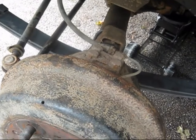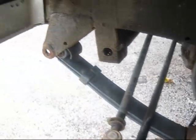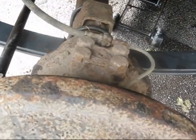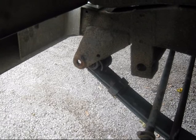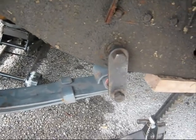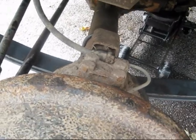I'm still having a problem trying to locate this side of the U-bolt and the pin. As you can see, there's quite a bit of movement left in there — it's not tight at all. So what I did is I dropped the front pin out, located the pin on here, put the U-bolts on and just pinched them tight so they don't come undone. Now I'm going to try and pull and shove and squeeze to get it on there, so I can put a small pin in to locate the hole and tap the bolt through. At least now I have some leeway and it isn't going to come loose. The shackles will travel further forward and they are loose, so I may just pinch them a bit tighter, then get everything squared up and re-square the U-bolts so they're sitting right.